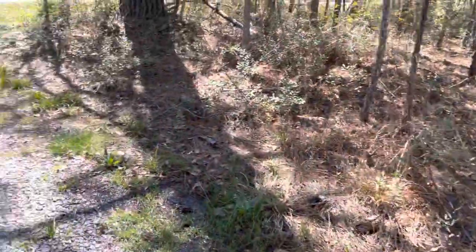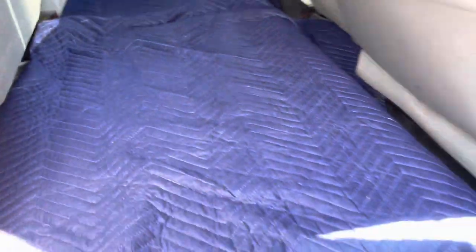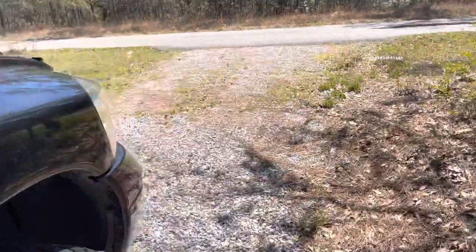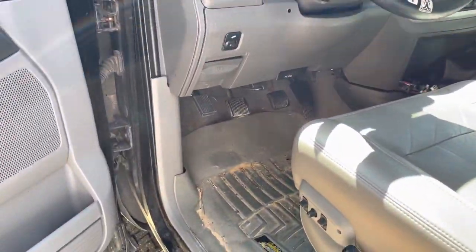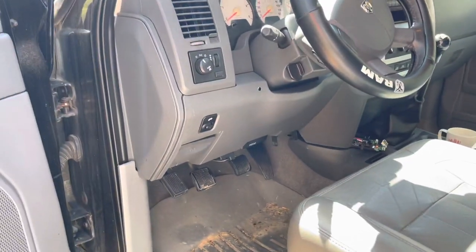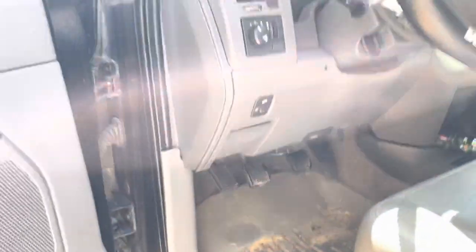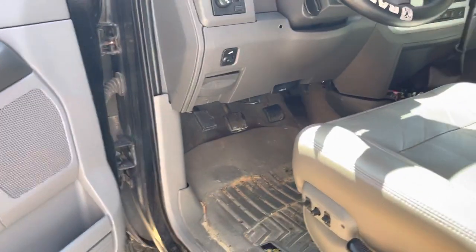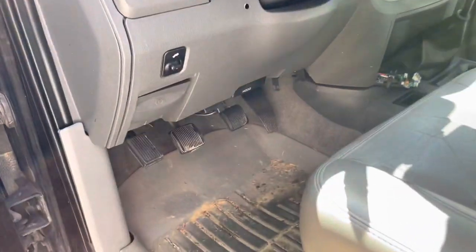In gear I still had a little bit of movement even with the pedal all the way to the floor because the clutch was still slightly engaged. So I decided to go get some brake fluid — I had some laying around, DOT 4, which is what I had. I filled the reservoir up, came in and started pumping the pedal, and my pedal started coming back. I fired the truck up, the clutch was fully disengaging, went for a test drive, and by the time I got back the pedal felt brand new.